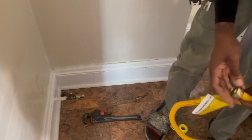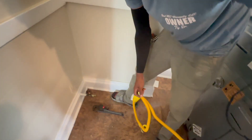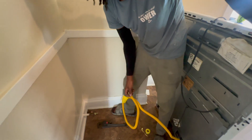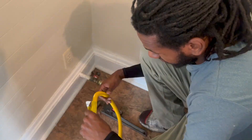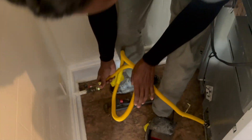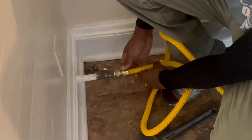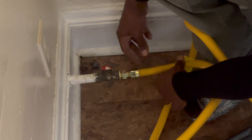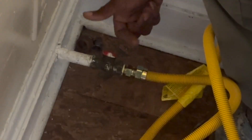I'm gonna do this other end. Remember you don't need tape on it, but you can put tape on there just for extra safety. I know some people get scared when they think about gas lines. Sometimes if your gas is not on, the gas company will actually hook it up for you if you got everything. Make sure your line is not gonna be kinked. Same way I did that — push it on there, get a couple threads twisted on, pull your gas line back, make sure it's straight, and tighten it.